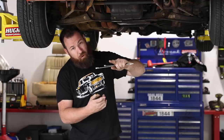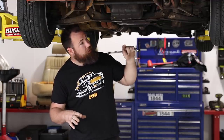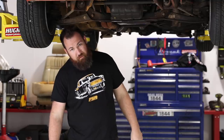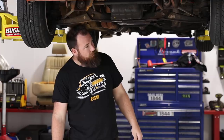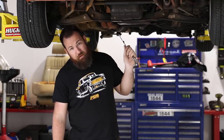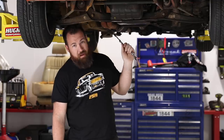having it sort of 400 mil out of the floor, you're never going to get an accurate position on where you've actually got to cut that carpet. So I think a much easier way is going to be to remove the shifter, trim the hole, and then refit it later. Potentially, if you don't do it that way, it could cost you a $200 plus carpet kit. So yeah, for the 10 minutes of mucking around, even if this is on the ground, it's only going to take sort of 10, 15 minutes to jack it up, knock the shifter out, and just put the carpet in that way. So we're going to whip that out and then bring it back down and continue along.